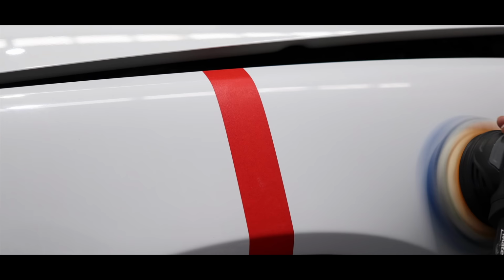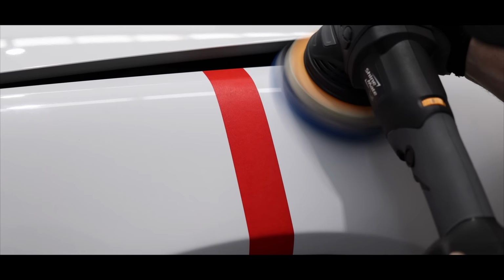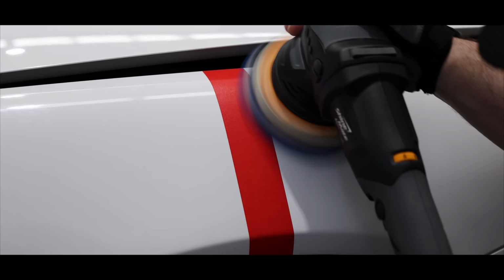The other thing to take note of here is that apart from the swirls and scratches, this paint and many of the trims have embedded staining in the form of streaks, oxidation, and even dirt and contamination that's fused to the top layer of the surfaces. It gives this originally beautiful white paint a dirty greyish and brown tinge that normal cleaning just can't remove. This is the added benefit and power of using a light polishing abrasive. It's able to shed that top, dull and dirty layer of paint to reveal such a clean and revived original paint finish hiding below.